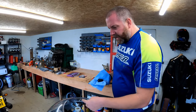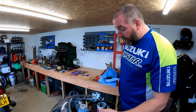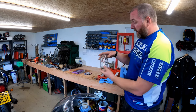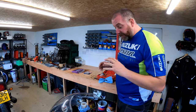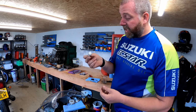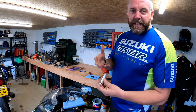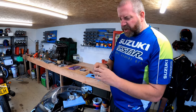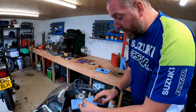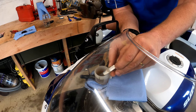Pay attention to this - it's your brakes at the end of the day and it may well save your life. I've seen brake fluid with the consistency and viscosity of orange juice with bits in. What I'm going to do now is grab a syringe and suck all of that out into my jar labelled 'dirty brake fluid'. I'm using a little five mil syringe - you get them with Calpol if you've got kids.